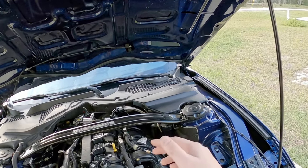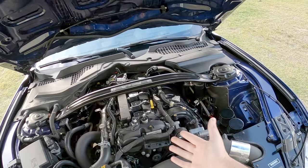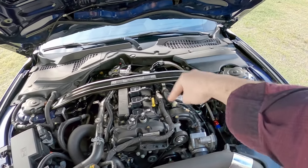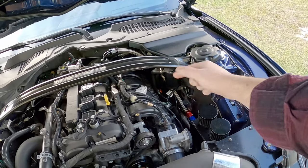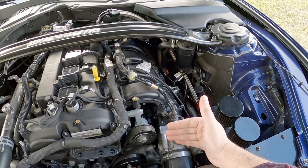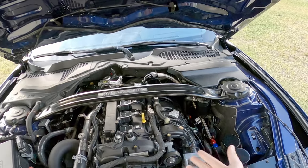If you do try making more power — like with a device like the Boost Max or adding a wastegate actuator — that's either tricking the car to make more boost or physically trying to push more boost. The car won't let you, because these two sensors are going to read whatever is coming in and they're not going to allow it. The throttle plate is going to close up as much as possible to limit the air coming in. You might momentarily see increased power, and I've experienced this — you've seen my car in my quarter mile videos where it has really good low end but then kind of tapers off up top. I've always complained it has no top end and it dies up top.